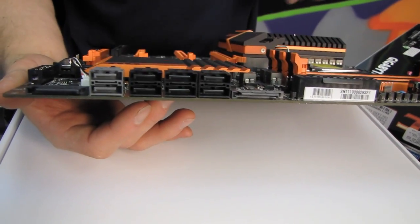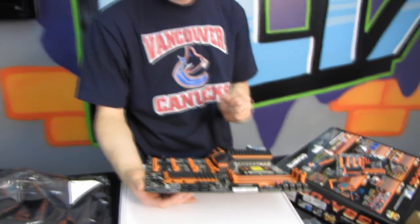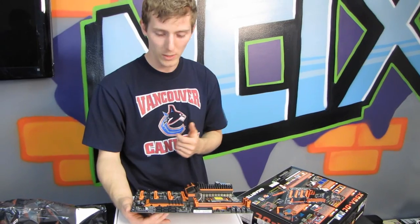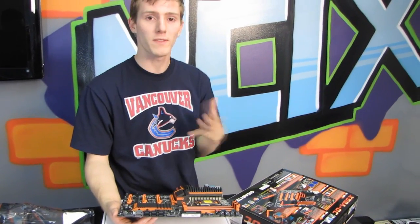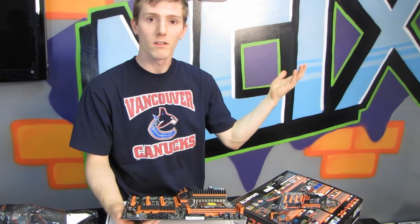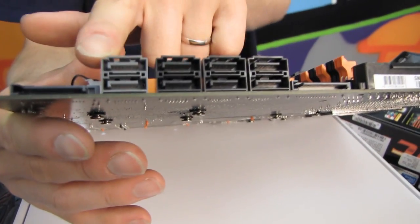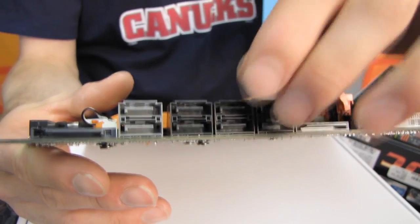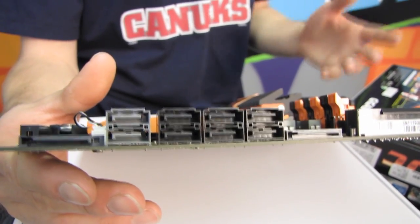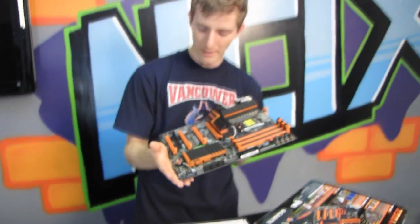Here's a smart design choice: two SATA power connectors rather than Molex. Molex auxiliary connectors are annoying because most modern systems don't use Molex near the motherboard, requiring a completely separate modular cable run. SATA power connectors are located near the SATA data connectors, which means they're close to wherever you're already running SATA power — probably near the front of the case where hard drives are mounted. You can run an additional cable or daisy-chain from a drive. Great solution.